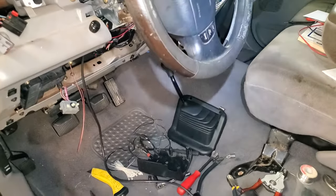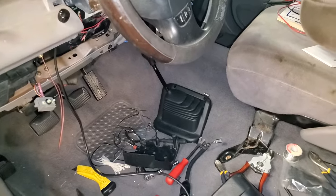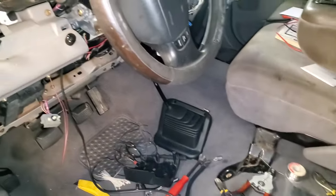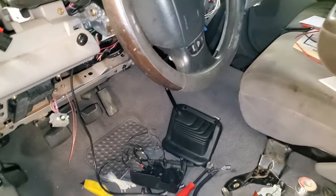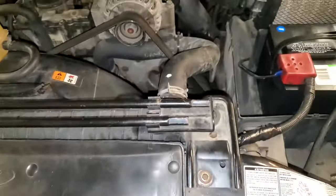It might take quite a bit of adjustment, but that's pretty much it. You don't want to adjust it too tight, because when you get back to center on your steering wheel it's going to be real tight. The return to center won't work very well — you'll have to do it manually, which can cause some pretty weird handling.